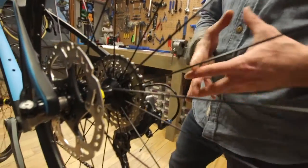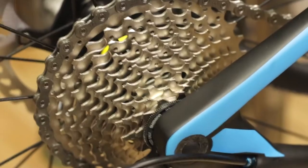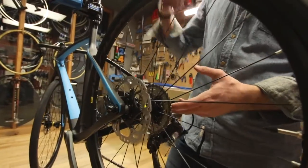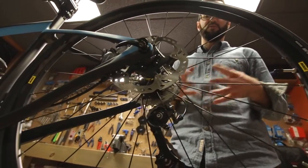With the Hatchet carbon and aluminum models, the rear end got a bit of a boost — we've gone to a 135mm axle spacing in the rear end. This is to accommodate the 11-speed in the back, the disc brake, and just overall giving the rear end a wider stance for more stability.